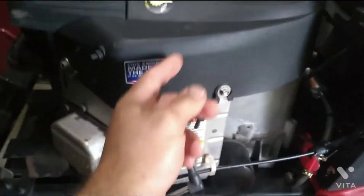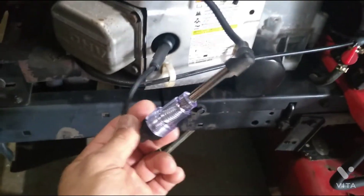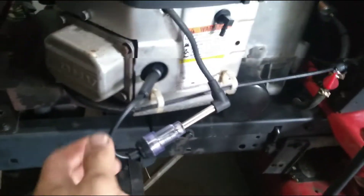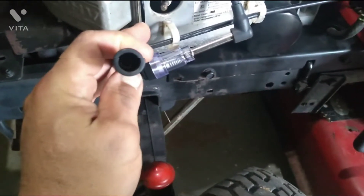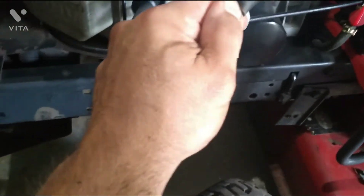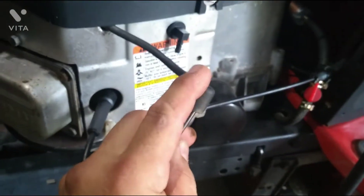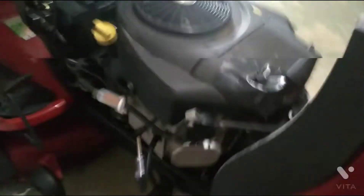Just like the two-stroke bikes that have a CDI or a coil — there's something in here where the spark plug wire goes, and also another wire coming off of it, I think it's a ground wire. So I went and bought these spark plug testers. You can check your spark, and this would also work on your two-stroke — instead of taking the plug out and putting it next to metal to see spark. This end is like the boot, it snaps on there, and the other end looks like the top of the plug, so your boot plugs into it — it just goes in-line with the spark. I got one there and another one there because this is a twin cylinder.